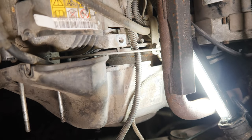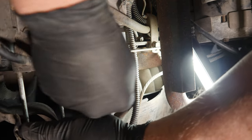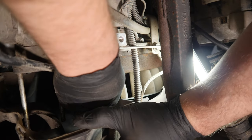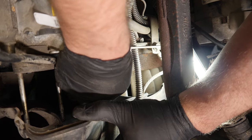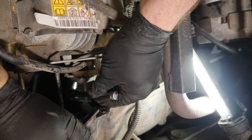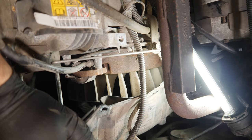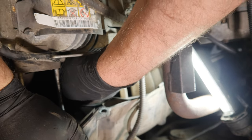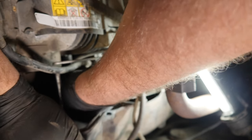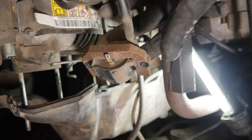The coil is held in with 10mm nuts or bolts — I got to try to pry this bracket back a little and get down in here. These are 10mm — I was right. Now I've got to try to get in here with a ratchet. That broke loose fairly easily. You could drill two holes in the bottom motor mount near to where those two 10mm bolts are that hold the bottom of this blower cover on and not have any problem. But being that this is not my cart, I am not about to start hacking holes. Now we've got the blower cover out — there's our ignition coil and that wire I was talking about.